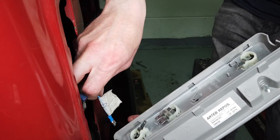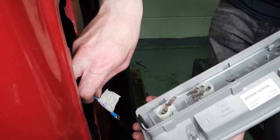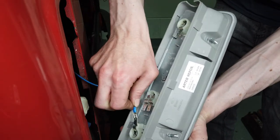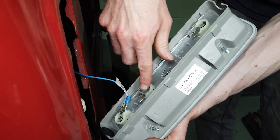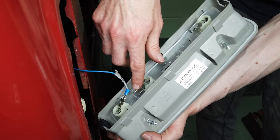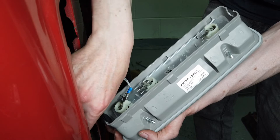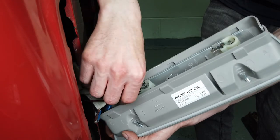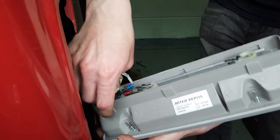It's very important to label everything before you pull it off the old light unit — just label all the wires because it can get a little bit confusing when connecting everything back up again. Starting from the bottom, we'll plug in the reversing light that goes in there, and then up here is a double filament bulb — one filament is the main light and the other filament only comes on when you press the brake pedal, so of course we put the brake light connector on here. These are nice and tight connections now, much better than the old ones.